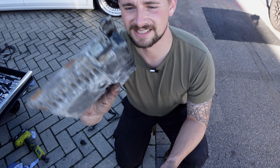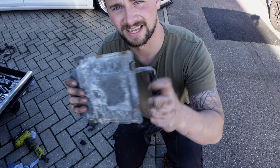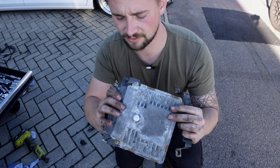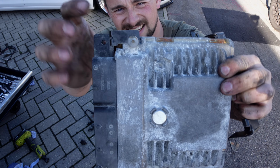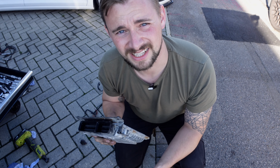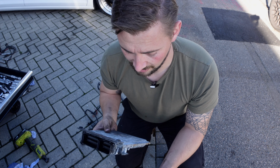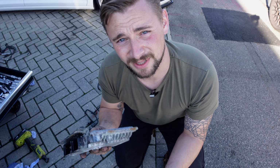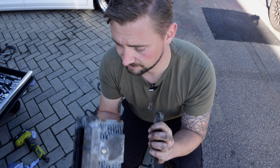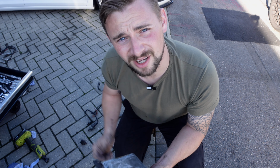So I just want to show you, this is the ECU. And to get the plugs out, it has a bracket over the top, which is held in with these security screws. I spent a long time yesterday hacksawing the heads off so that I could remove them. All I've done is I've found a couple of bolts with the same pitch thread. And once it's all connected back in, I put the bracket back on, do the screws up, jobs are good.